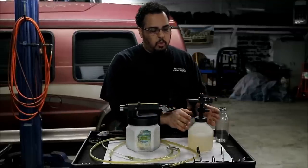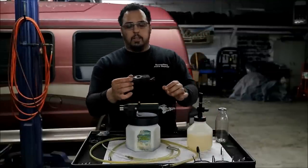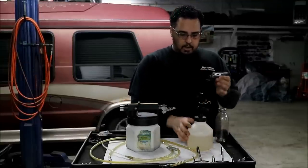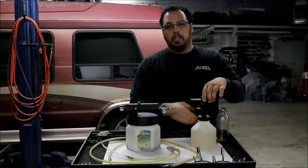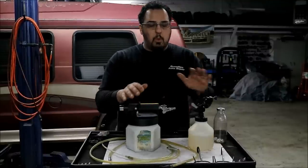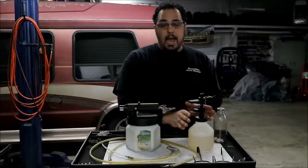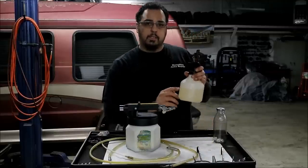This tool is basically a kit. It includes a fluid reservoir that goes on top of your master cylinder — there's a little bracket that you twist onto the master cylinder. Inside the master cylinder cap area, you turn this piece upside down and adjust it with a metal clip. There's a lever to open and close the fluid so you can fill up the master cylinder. While you're sucking air with the pump, this reservoir keeps feeding fluid so the master cylinder never goes completely empty. Make sure you fill both the master cylinder and this reservoir together so you don't run out of fluid during the process.